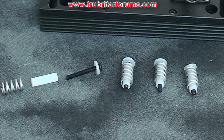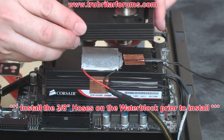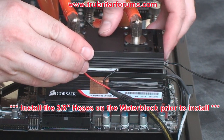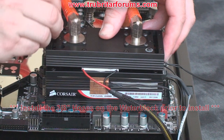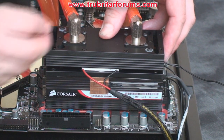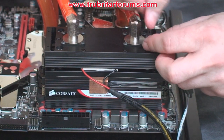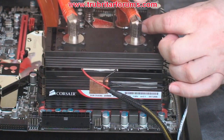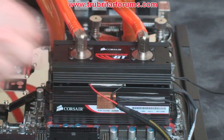For this installation you will need to pre-assemble these using your black screw, plastic washer, plastic standoff, and tension spring. Pre-assemble these before installing the water block. Lower and line up your water block with the four remaining holes on your thermal plate. Next, install your four pre-assembled tension spring assemblies. Tighten up your tension spring assemblies again using a diagonally opposite pattern. Finally, install your water cooler cover.